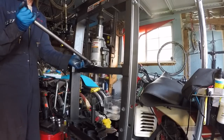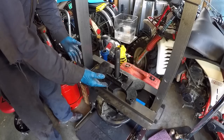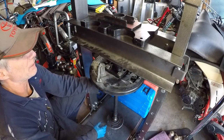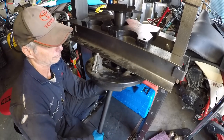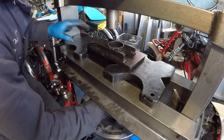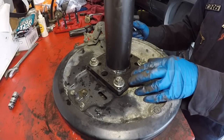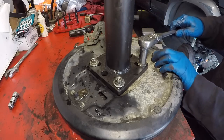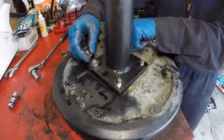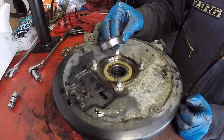Release pressure on the bottle jack and have it go back up, then screw the bar screw back in. Raise the crossmember back to the top position. Lift the assembly, pull the axle out, then support the weight, pull the press plates out of the way, and lower it down. Get the tool off the backing plate by loosening all the nuts with the 14mm socket. Now you have the axle free of the bearing and the outer retainer free.